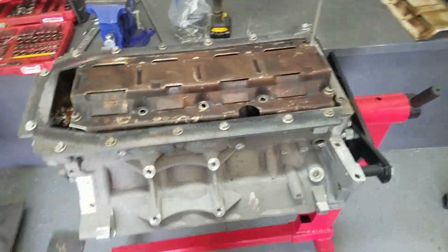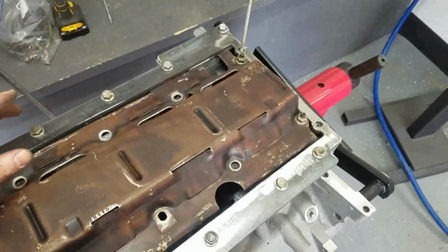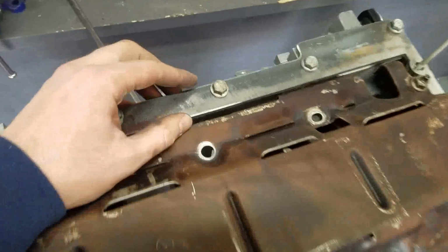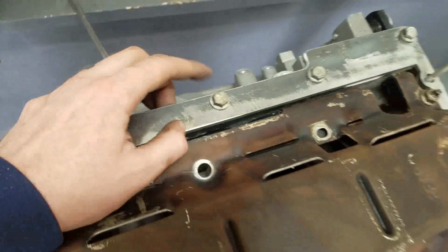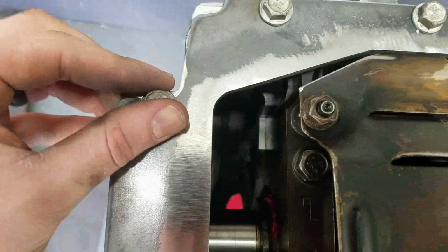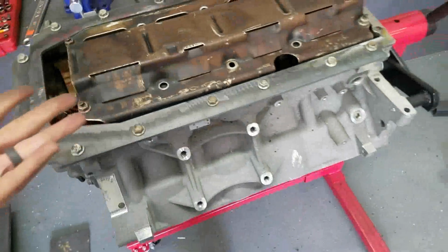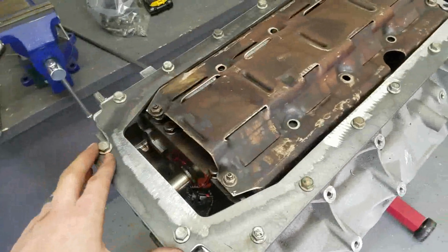While I'm cutting out the new flange, I bumped a piece of slag on the final cut. And it offset the outside perimeter. If you look, these bolts are closer than these bolts are. They're supposed to be equal distance. And this guy out here got like real close. So it's fine. I know it's there. Now you know it's there, but it's going to be all right.